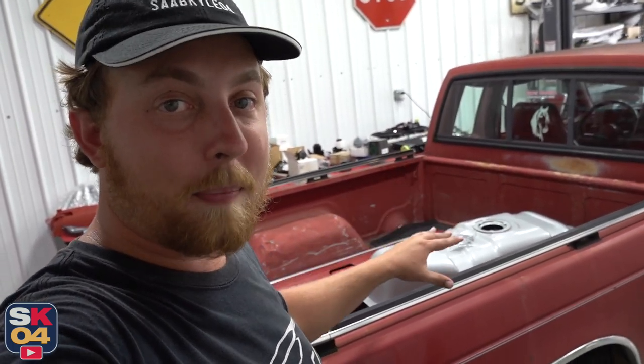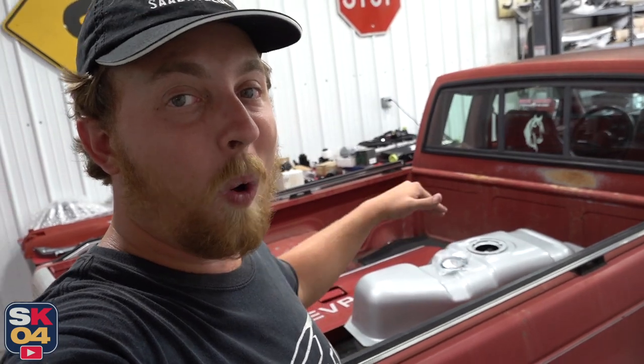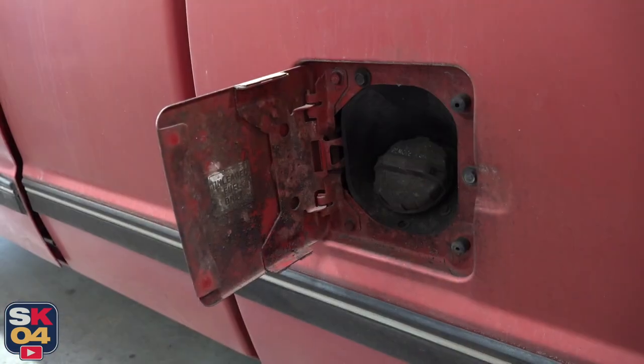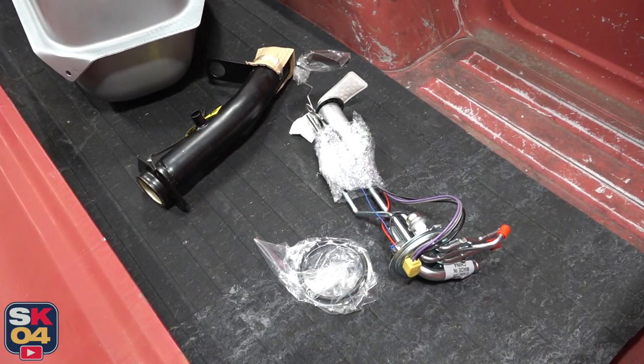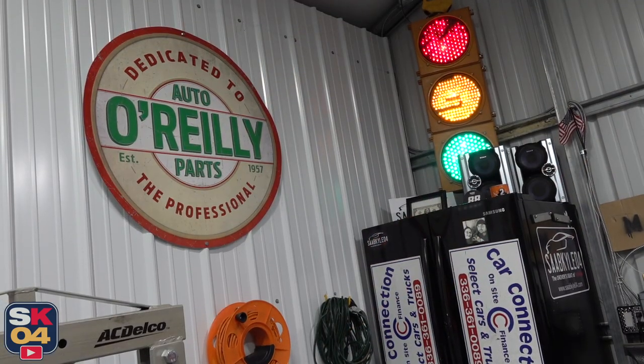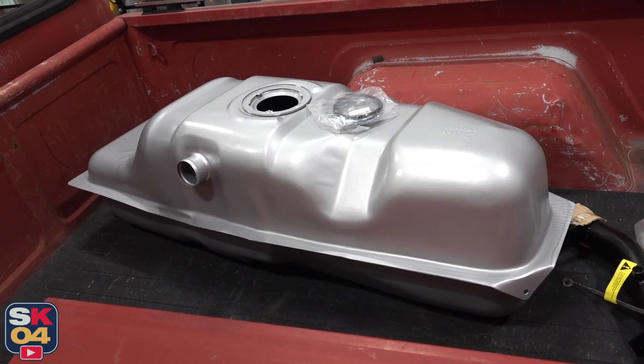Because the sending unit goes in the top of the tank, the proper way to do it is to drop the tank. I've actually seen people cut holes in the bed to make it easier to get to that sending unit without taking the tank out. We're not doing that, but because I have the lift to make things a lot easier, I'm going to take the bed off the frame, because it'll make it a lot easier for me to film this video, and I can knock out a bunch of stuff back here all at once. While I'm in the midst, I'm going to replace the tank, the filler neck, and all of the hoses. A huge thanks to the folks at my local O'Reilly Auto Parts for helping me get all of the right equipment in order. So let's go ahead and fire this up and show you what's going on.